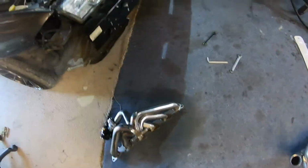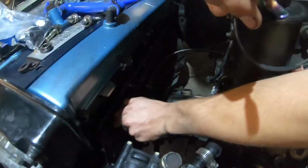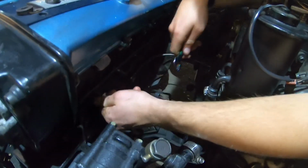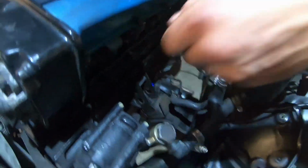So it's been 20 minutes and we still haven't got the manifold on yet. Yeah, we ran into a problem, so we got a snapped exhaust stud. Just weld a bit onto the end of a screwdriver or something, but I can't be bothered. And then it didn't fit, like half of them weren't going, so we just put all the studs in the bottom. Now, hopefully it's right.